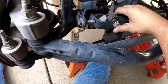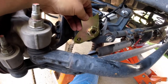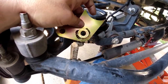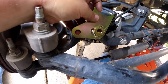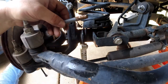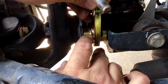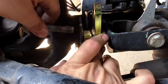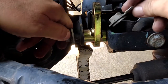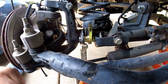The passenger side is a little different - you have your track bar bracket. You'll get a flag nut and a bracket that will actually bolt in. This will go up against your actual housing, and then the pin will bolt through. Just like before, anti-seize goes on. This one already has a built-in spacer on it - it'll just go in, bolt through, and then the flag nut will go on. That's why you have two different links for the disconnect.